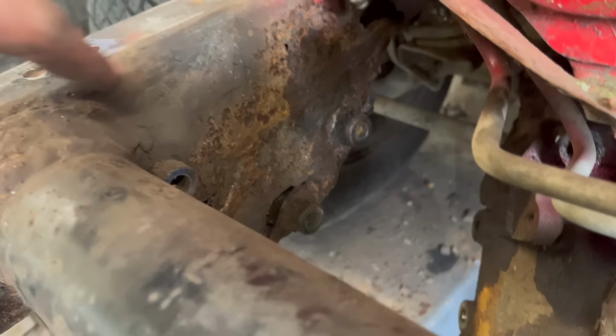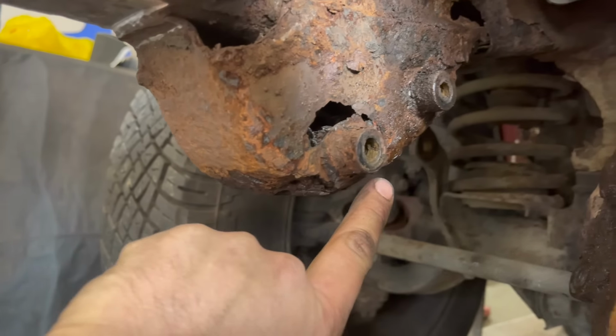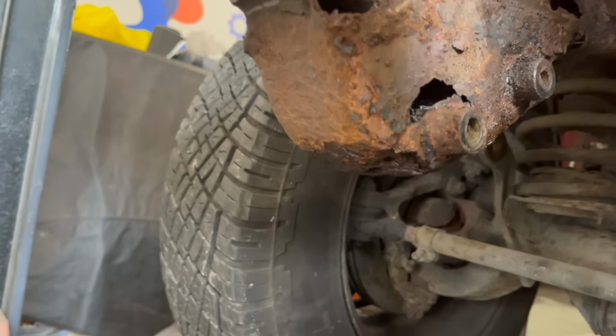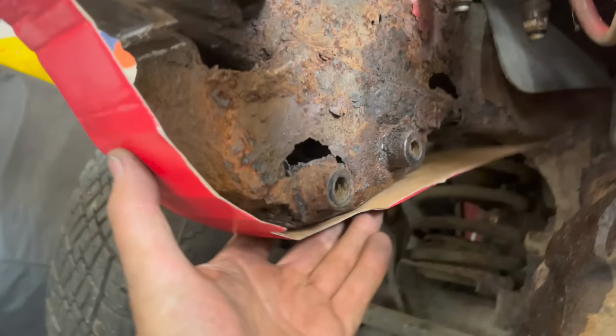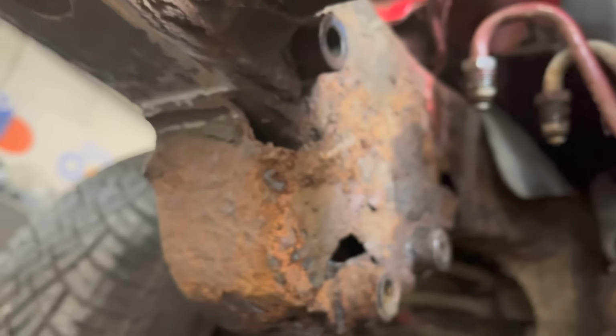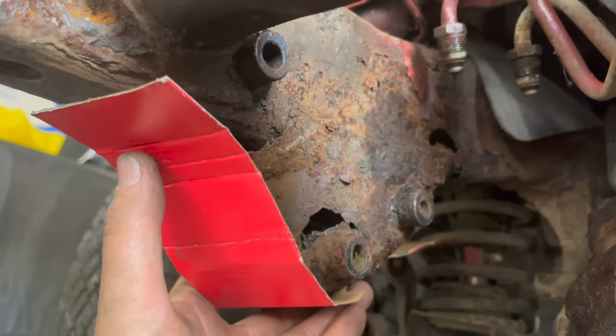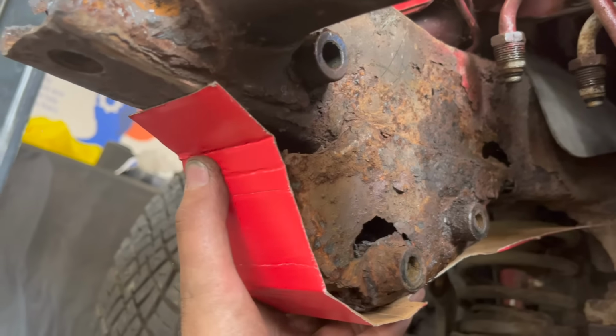I might end up taking this side off because of the pump, so I might end up chopping here, chop along there, and then get all this removed. And then this piece is the bit that will wrap around right up the top there with 5mm extra, so we can get it welded on to where it's nice and clean. In there, just take all this surface rust off, get it all over plated, clean back, put some rust cure on in the rusty bits, which isn't going to have any welding to. So just a nice over plate in there with these.